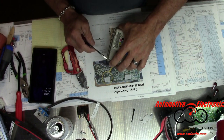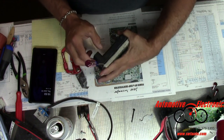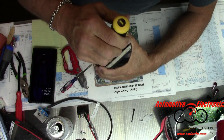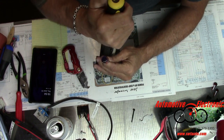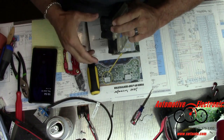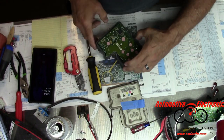Once you get to that point you need a little tiny screwdriver. Get in there and rotate that up. Get on that edge and rotate it up to where you get a little gap in there. Then you want to get yourself a little bit bigger screwdriver. You want to be able to look down in there and you'll be able to see the circuit board. Just barely get your screwdriver in there, get a hold of it, and rotate around. Now you've got a nice little gap going on. I can actually hold it with my fingers at this point and just pull off that top without pulling on that circuit board underneath.